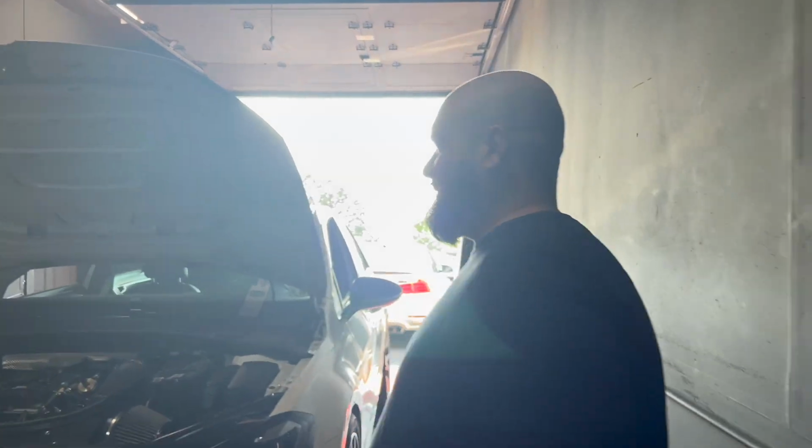Meanwhile. All right, Nick. What do we make? She's all done. What did I say I wanted? A 450 wheel, right? Yeah, you want a 450 wheel. All right, so we could go up to an E60 blend. Right now with the gas that we're running, there was a little bit too much pump gas in the car. So with the pump gas that was in the car and the E85 that we put in, we're at an E45 right now. So from E45, we go up to like E60, E65.